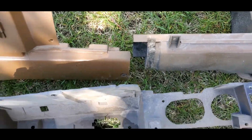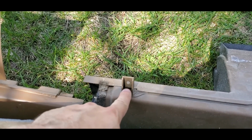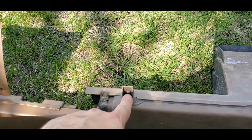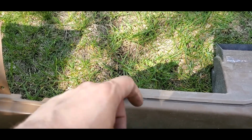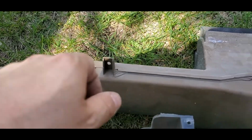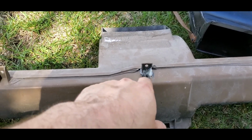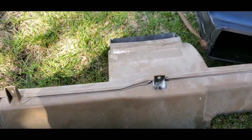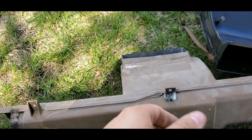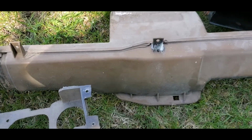Nothing too crazy there. Be very, very careful with these tabs. Do not use an electric impact, like a Milwaukee electric impact or an air wrench or anything like that. Tighten these by hand with a little 1/4-inch ratchet. You will break the studs off. I dropped this and broke that one, so good for me. I got that back on there with epoxy, 20-second epoxy, scuff everything up, 80 grit. You can shape it down, you can paint it, you can finish it out. Just fixed it, so we're good to go.